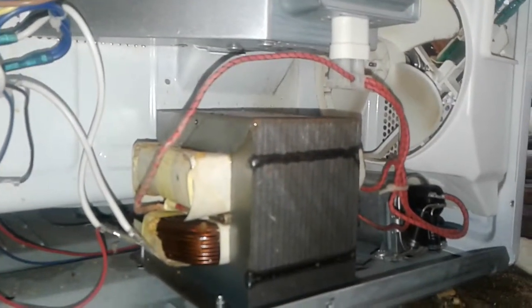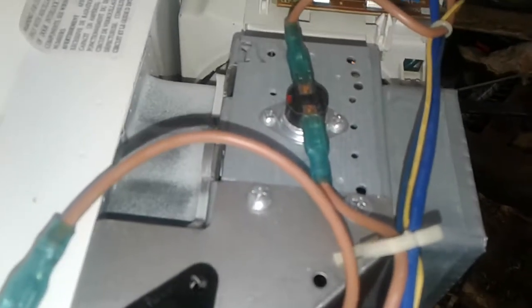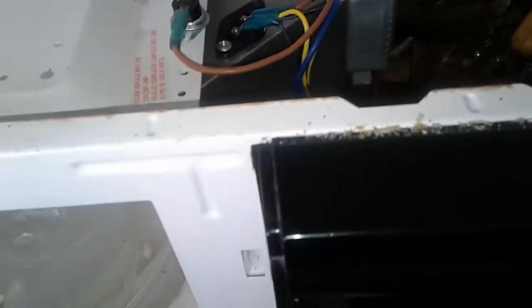Here's another high voltage sticker - it's just falling apart. It's got so hot in there that it just melted it off. Inside here is one of the goodies that comes in through. This right here is the actual radiation system - this right here is the, the actual magnetron. Let me open it up. See right here? The plate that sits right here? That plate in there is hiding all your electron gun. This microwave is crusty and it was headed to the junkyard before I grabbed it, so I'm gonna make a lot of use out of this.